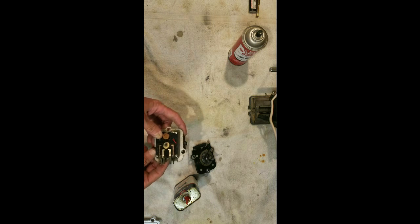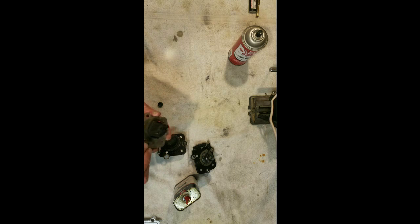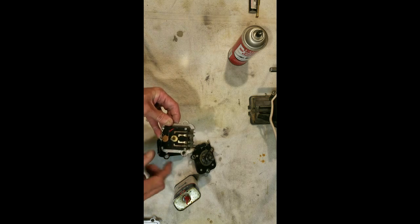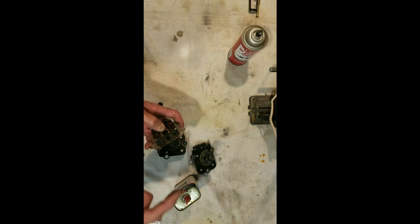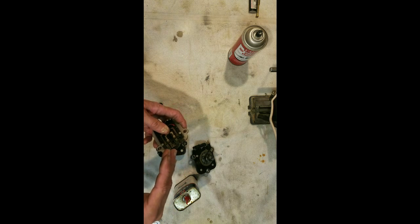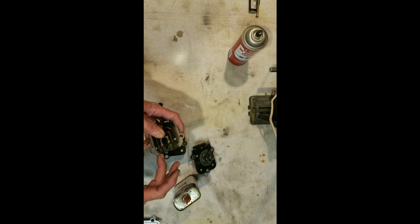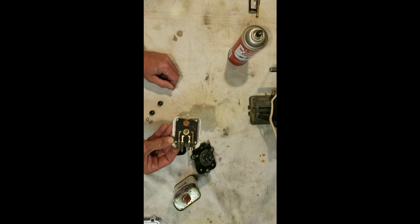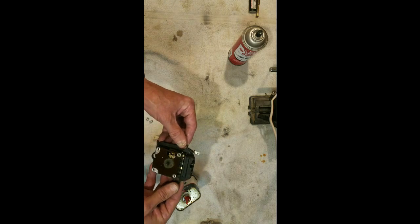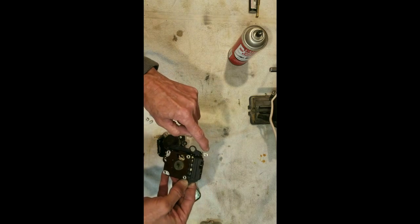This is one that has been put on the car - it's got the same principles of operation but you can't get in and clean it out. It's got all kinds of stops on it and I'm not sure it's got the return to neutral. Like on the heater flap, you want it to open about a quarter of the way and there's a little notch in the valve the thing should open to, and then there's a full open. I don't know that these will give you the positions on the valve you need. This is a Lucas 4-pin, which is what you want, and there is a ground on it.